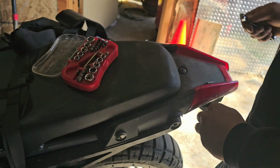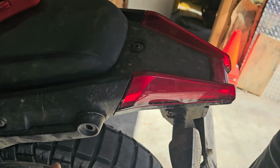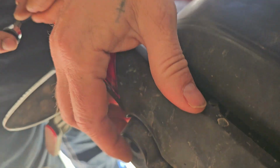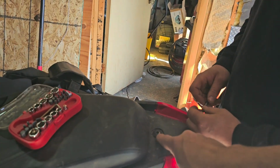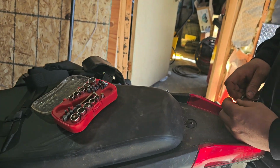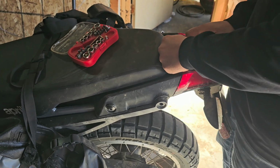And so we're putting Cody's on. He's removing these back bolts. These are going to be a T30 bit to remove on both sides. And then we're going to remove these front ones as well, both sides. And this back one, these are 6mm Allen heads for removal. And then the install is going to be different, so we'll go over that here in just a minute.